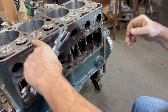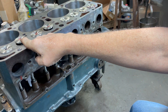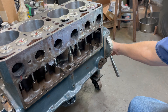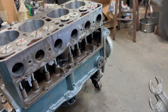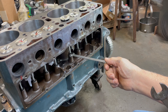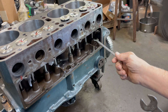This is the same all the way through. If I wanted to adjust number one intake valve, I would get number four intake valve to the top — now it's ready. When I want to adjust number four intake, I get number one up, just rolling around until it comes up, and now number four is ready to adjust. I don't have any valve springs on yet because with these three-wrench style lifters, I have to cut 30 thousandths off the stem so you have adjustment, because these lifters are taller and you don't have any lash.